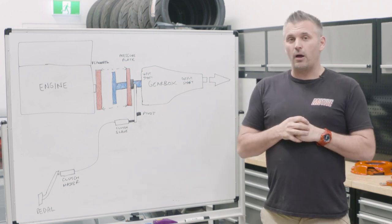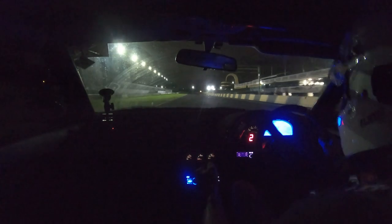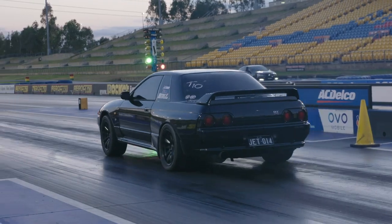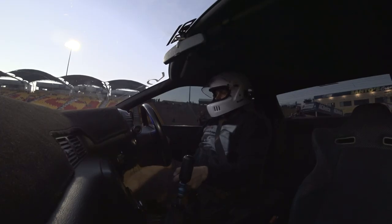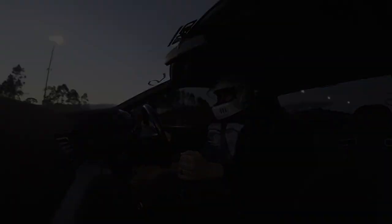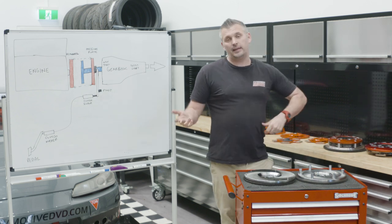That carries over to drag racing as well. We'll use our GTR as an example. We have not gone for the lightest possible clutch in our GTR, because when you go to launch the car from 8,000 RPM with four drag radials on the car, as you start to release the clutch, the lighter the flywheel, the more it's going to want to pull the RPM down and the harder it is to launch the thing. When we have a twin plate, the whole assembly is actually pretty heavy — it can be upwards of 15, 16, even 18 kilos depending on the brand. You've got that inertia, it makes the car easier to launch. So in a drag application, sometimes not going too light in the flywheel is actually a good thing.